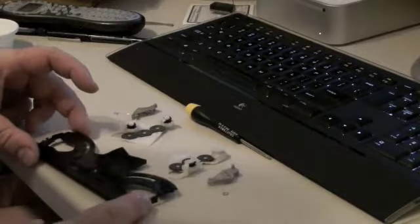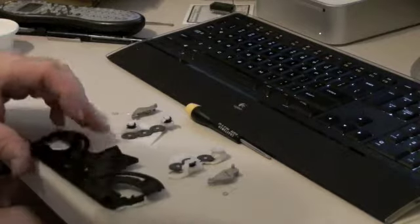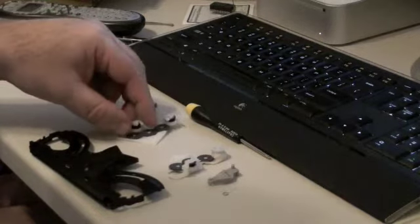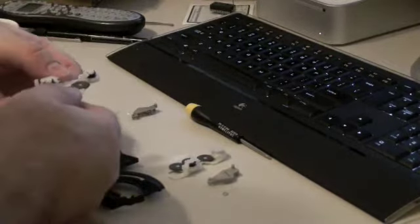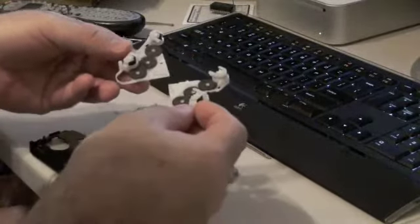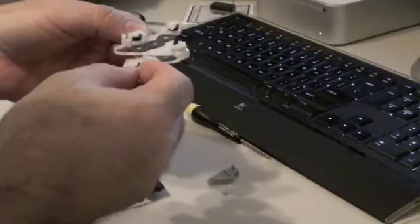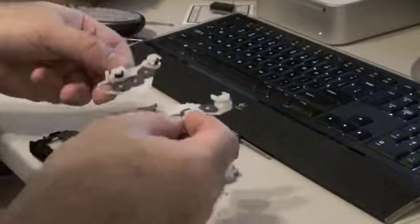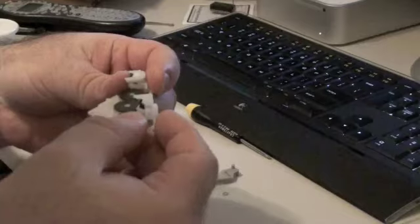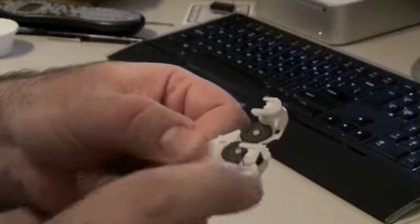Okay, I've got parts of the Blu-ray drive apart again. This is the part that takes the disc in. There are two arms that pivot when you put the disc in, and that makes the disc right along these little rubber pieces with gears on them. And the reason your disc is drawn in is because this thing is actually powered. There's a gear train on each of these arms.